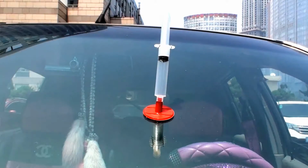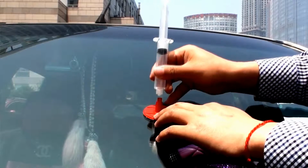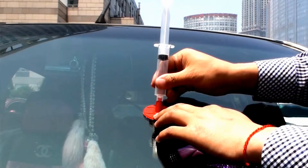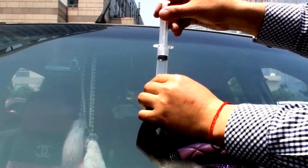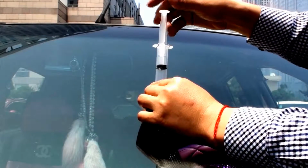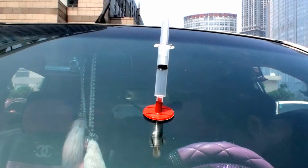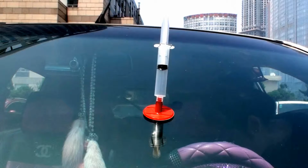Step 6. Remove the syringe to break the vacuum and allow air into the pedestal. Now, reinsert the syringe so that it is airtight again. Holding the syringe in place with one hand, press down on the plunger with the other hand and lock it in the upper notch. In this step, you are using the sealed space and the airtight plunger to force the resin down into the break. Leave the assembly in this position for at least 20 minutes.